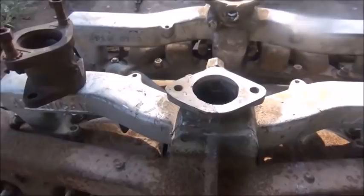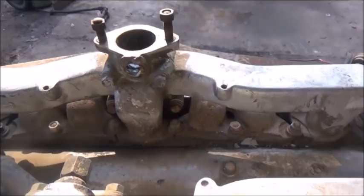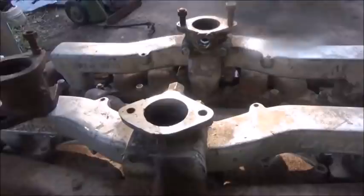I had a hard time getting this out — somebody had welded this one up and had a plug in it. You can't run a plug there. You've got to have something to equalize these manifolds. I don't know why they had a plug there, but anyway, it's out. So we're going to equalize these manifolds together, vacuum-wise.